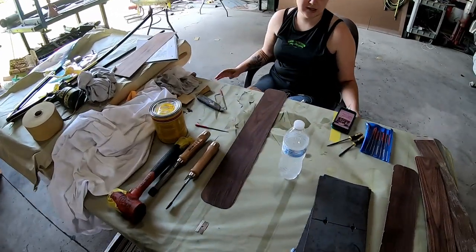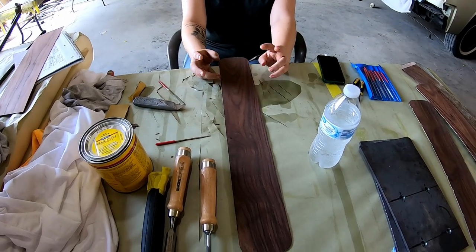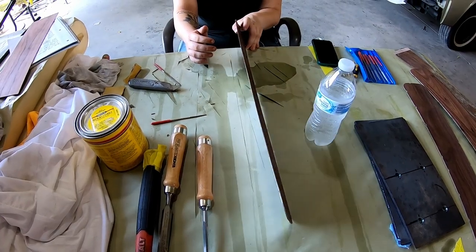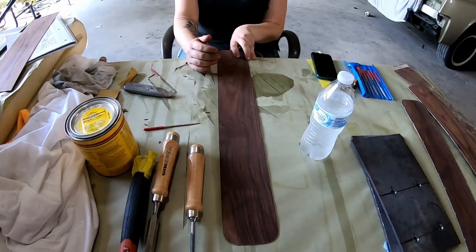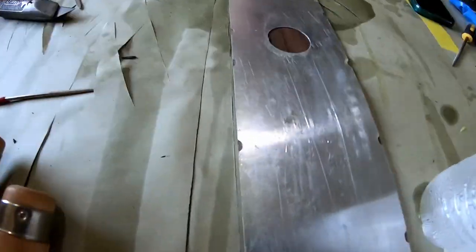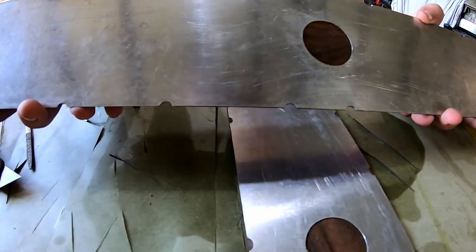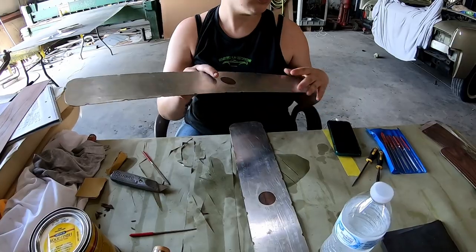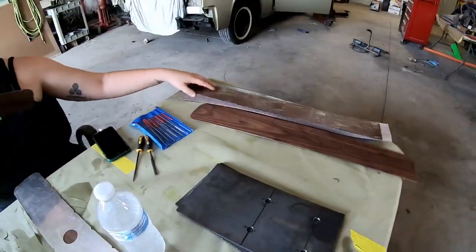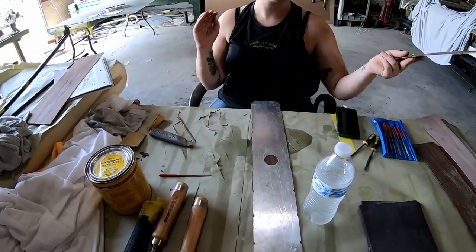We're going to clean all the veneer. What we have here is the veneer laminate — these are the door panel inserts and the glove box inserts. We removed and soaked the original wood laminate off with lacquer thinner, and then we had a cabinet maker make us some wood sheets because we don't have a planer. Yesterday I glued them on and stained them, and today I'm marking out and filing all those notches — those are the retaining notches for the stainless trim. I've got to drill out the holes still. I have three more to do, and the last one needs staining because we couldn't use the original piece of laminate — it bubbled because of the humidity. Then we'll polyurethane them and eventually they will go back into the door panels.